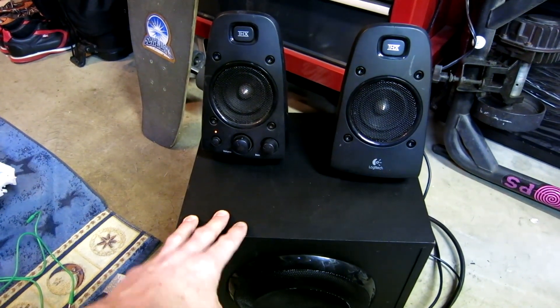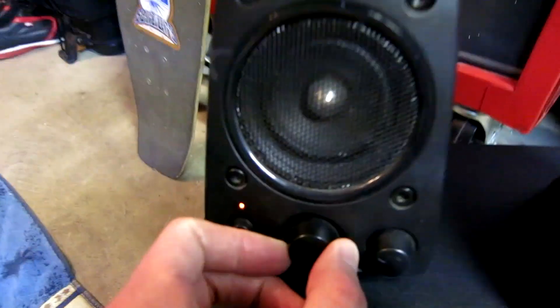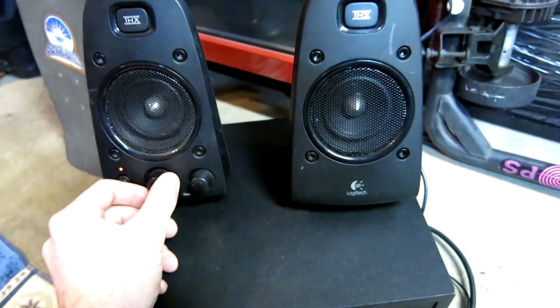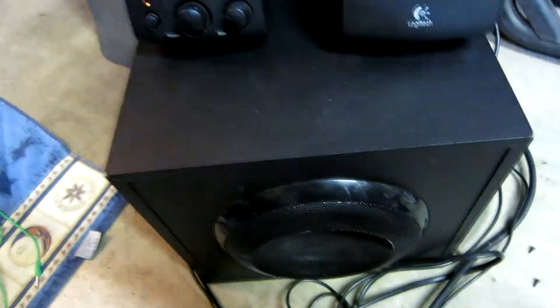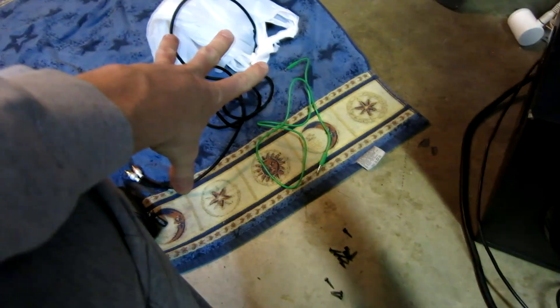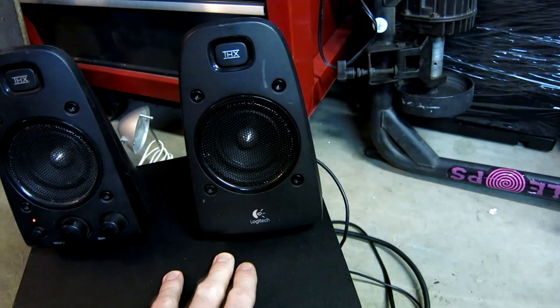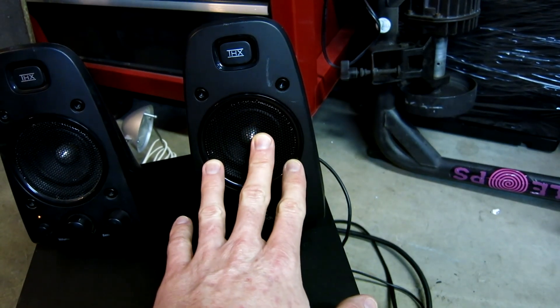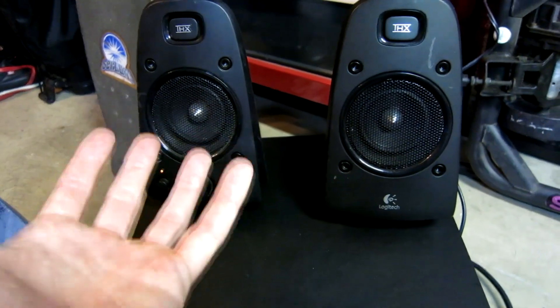What I'm experiencing is white noise out of the speakers when it is plugged in. With it plugged in, I'm getting white noise, but there's no sound when I hook up either my AUX cable to my iPod, or this cable that goes into your iPod or iPhone. Either set of cables does not work. My speakers do work though — I've hooked up my left one, which is detachable, to another system and it's getting perfectly clear, good sound. I'm just not hearing any music.